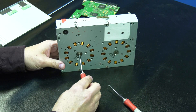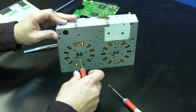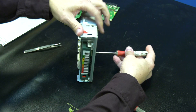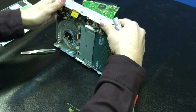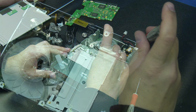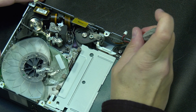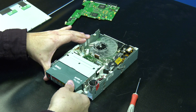To rewind the tape, use a screwdriver in the bottom of the drive to engage the front spool. Rotate the screwdriver clockwise to wind the tape back into the cartridge. Once the tape has been rewound all the way and the screwdriver will not turn any further, you will need to locate the deck drive gear. Use a screwdriver to push down and spin the gear clockwise. This will raise the deck and push the tape out and it can be removed.